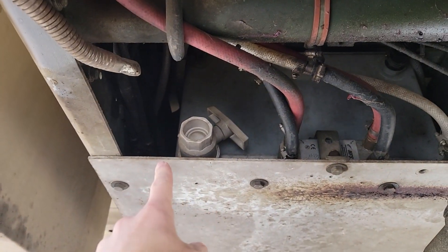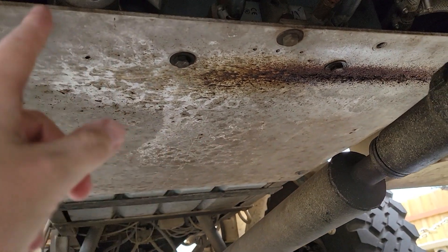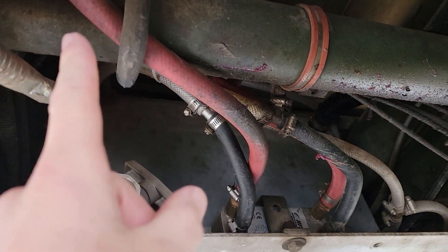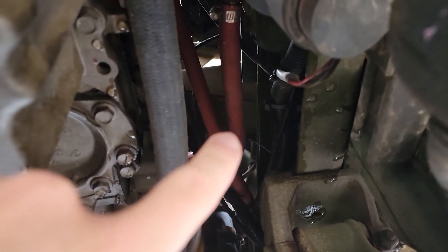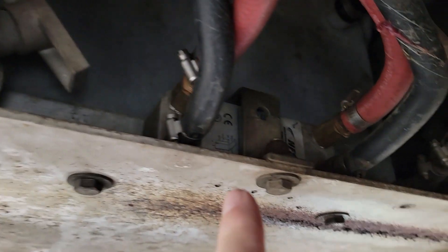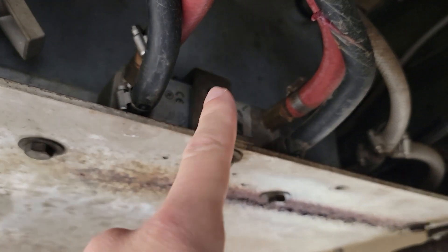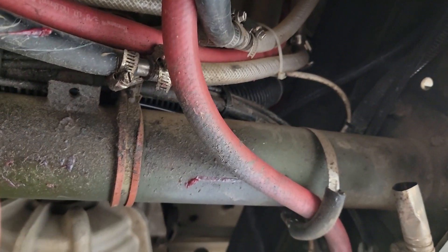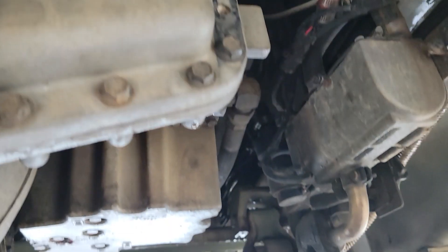I have the exhaust routed around and into the frame rail tunnel of the truck, and what that does is it acts as a defrost to keep the tanks from freezing. This is a mess of coolant lines — you have a coolant line up here that comes from the motor and returns to the motor, that comes into the pump here and goes through a line that goes through a plate exchanger for hot water, and then I used it as heat trace on all of the water lines so they don't freeze, and then that transfers up to the shelter.